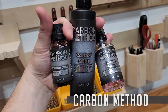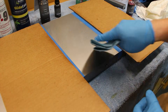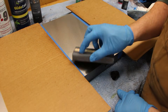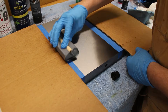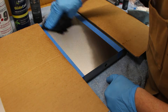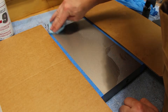The third test method is a newer product called Carbon Method. This has received some high praise online but the application is much more complex than other options. When I told them I was doing this review, they provided me with a sample kit with the understanding that I would give my honest opinion. There are four main steps: first you prep the surface with Carbon Cleanse, then you apply the Carbon Coat ensuring complete coverage, next you level the Carbon Coat, and finally you buff the surface. This product requires three to four coats because they're super thin. At the end, once they've fully cured, you spray with Carbon Glide and then you're ready to go.